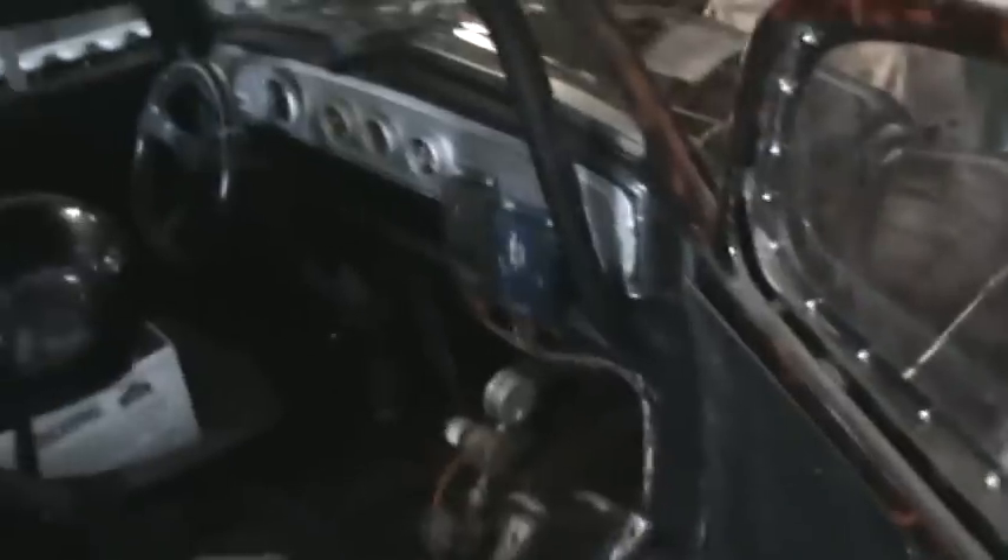The name of the car is My Kryptonite. I suck at the camera thing but I'm getting the hang of it, starting to learn. There's a couple inside shots. The blue box is a nitrous timer, which isn't on the car right now. The brown box is a delay box which is set up for bracket racing — you want to use the top bulb to go off of instead of leaving off the green or the bottom yellow.